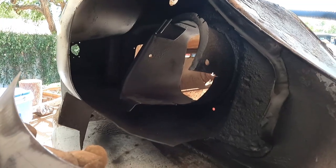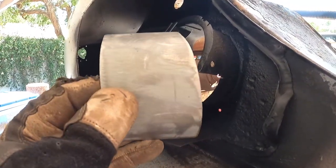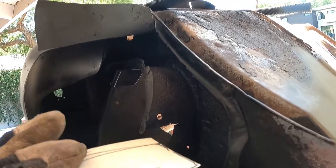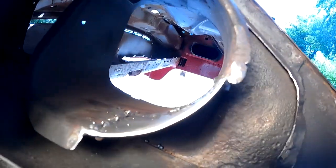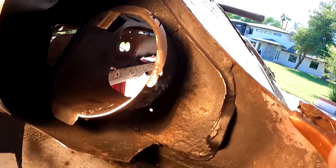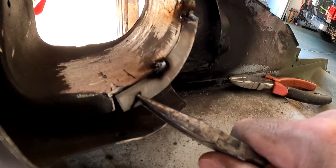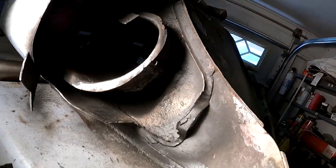That inner structure is actually made out of 20 gauge, which is the same material as the back panel. So I took from the old back panel piece I have, bent it over the rear axle, and we're going to get it in there. I've already made my paper template. It came out pretty well. There's another rusty spot down there that I need to use my copper slapper to fill in. I don't care what it looks like on this side — just finish these welds out, and then I'll make the lip. The inner drain is like it never happened.